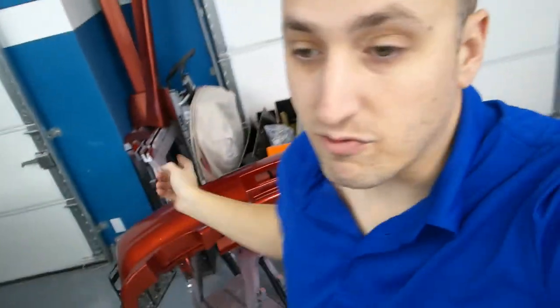And right now I'm going to freshen up these lights because the lights that I just pulled off that old bumper have overspray and are dirty. So I figured we can just clean them up. Probably just maybe get a cool LED light or some bulb to put in there. I'll just probably take some 1500 or 2000 grit and just clean them up like that. And then I have some little clear coat. We'll just clear them, be done with that. So I'm going to start working on that and get this thing back together.